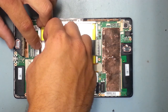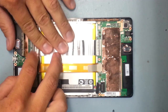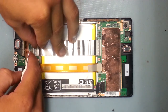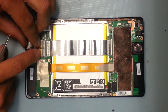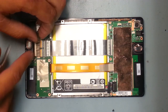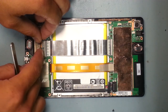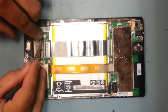Then connect the silver ribbon cable. Clip down the latches to lock the ribbon cables in place — same with the bottom two. Press them using the little tabs on the side, making sure they're snug inside the latch, then latch them into place. Then plug in the speaker cable into the little slot where it came from.